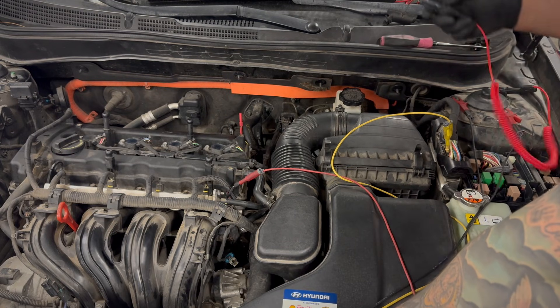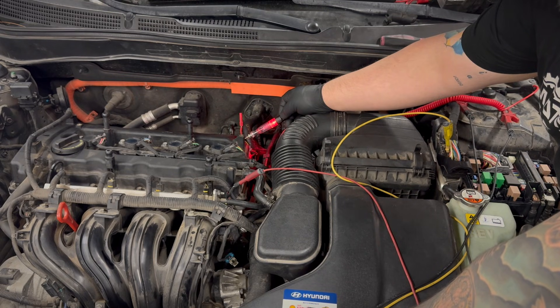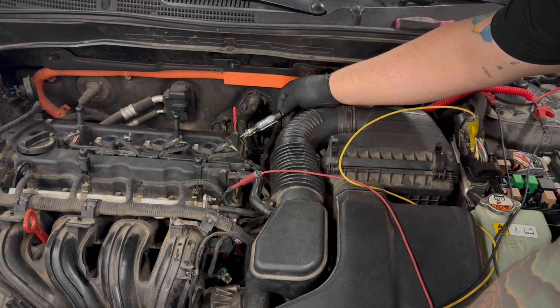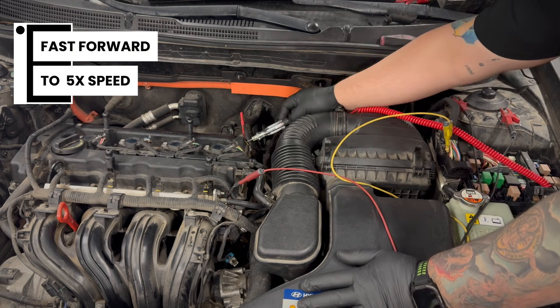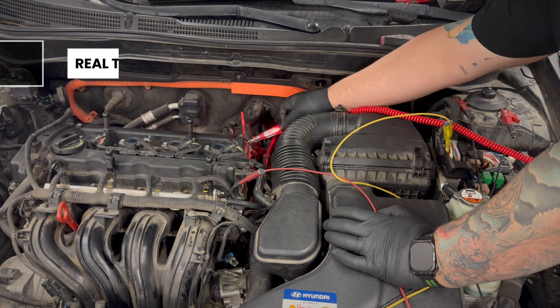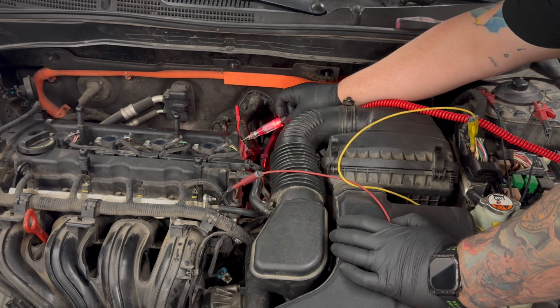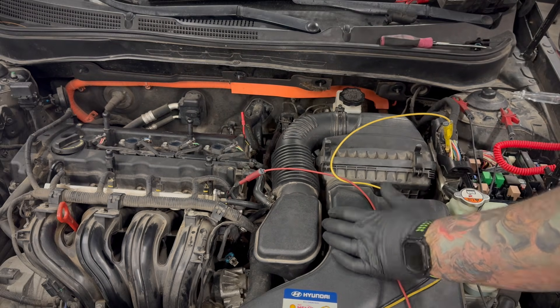Right now I went to the ground on the strut tower and my red wire is my power feed. And if you notice, we're actually getting a light on. So this means we can sustain at least a 32 milliamp draw and we're getting power — our ground is okay. So I'm going to do another test where I have a power feed over here in my fuse box, and the white wire in the center is my actual ground. We're going to rerun this test but now to the ground side. I'm at the power of my fuse box and I'm using the sensor ground — I'm getting a lit test light. Because of that, that's telling me that my ground is okay up to the sensor itself.